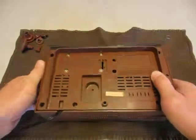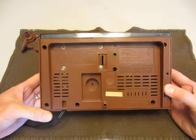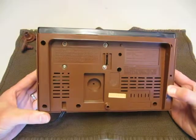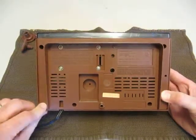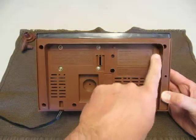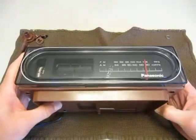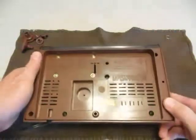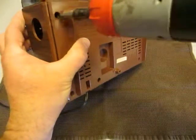I'm going to go ahead and flip over. The next step is to take out all the screws. I'm not going to pause because I want people to see the exact amount of time they can expect to take one of these apart. The cabinet screws — there are six. Then there are four clock mechanism screws. I'm going to go ahead and take all of them out.